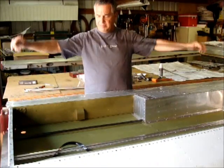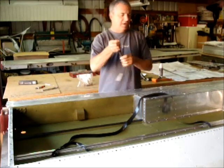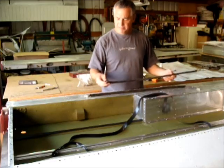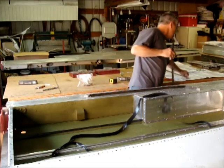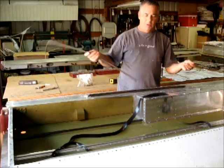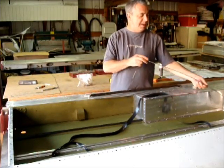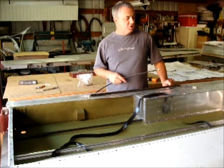We're going to start putting our rubber straps down in the half sections, but prior to that you've got to deal with the straps that hold your tank down. These used to be riveted to the butt rib — I just took them off for ease of painting. Put those back on, cut them at about six inches or so, then take one of the extensions that come with the kit and attach that where you cut. This end will attach to the straps you riveted on the flip side of your solid rib.